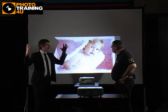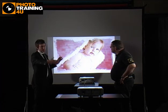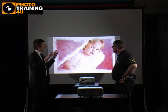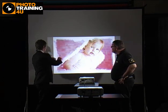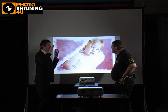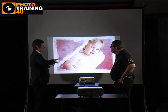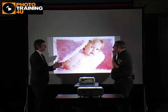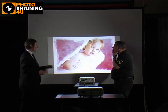So if you've got a lot of sunlight coming through, the further you take back the projector, certainly on this one because it's not got zoom, it gives you a bigger image, but you're stretching the pixels. The image is made up of lots of pixels, so stretching them makes it duller, and the ambient light also drops the light level. So the closer you can get the projector to the screen, the greater quality image you're going to get.